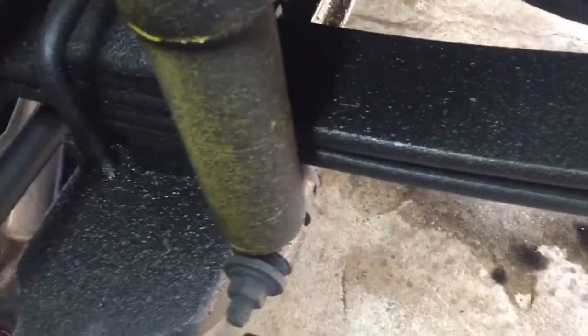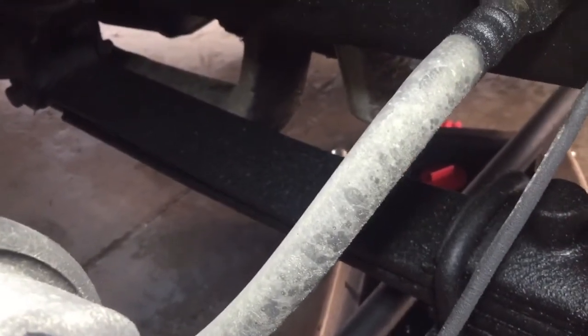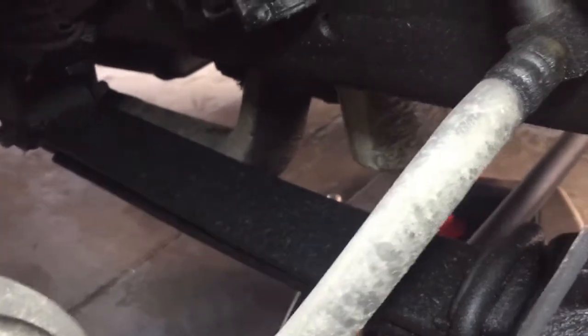As you can see, this leaf spring is completely saturated in oil, and the oil is going back. See that exhaust pipe? And look at that filter. Just by looking at the filter I already know that whoever did the oil change on this one previously used the wrong filter. The filter that goes on this particular unit — it's a DT-466 — these engines take a 7744 XD. The ones we have here are all black. This is a 7701, which is meant for a MaxForce DT, so they installed the wrong filter on this unit.